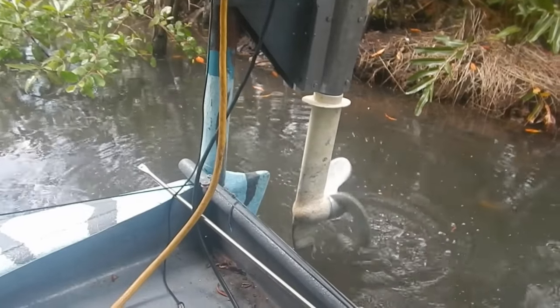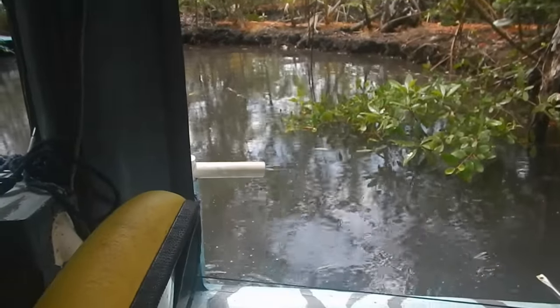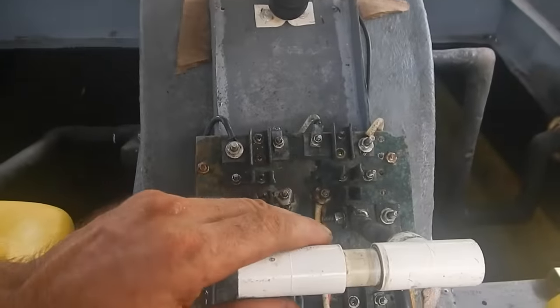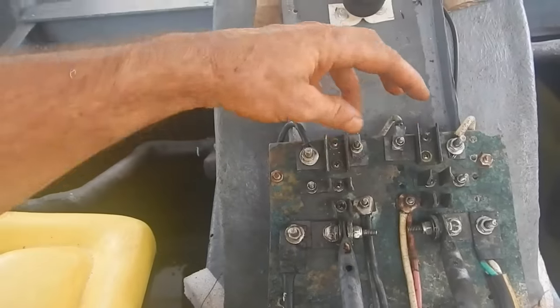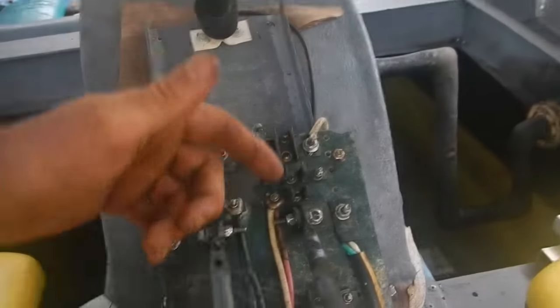Right now it's raining and there's hardly any sun out. When I move this switch forward and it contacts right here, that connects a couple of solar panels — and it doesn't reach the batteries until I connect way up here. I already turned the battery switch on, presuming based on my last motor it wouldn't run on solar in this low light. But it looks like this motor has a way lower startup amperage — so that's great.